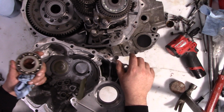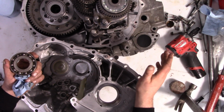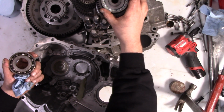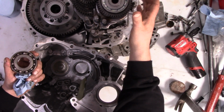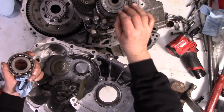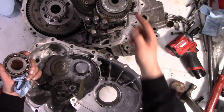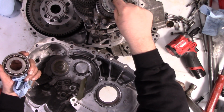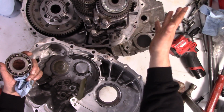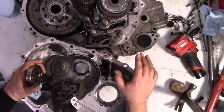So if I do this, my question is, is it really going to recirculate? Is the swarf that's generated in here, very little, but over time, is that going to make it out to the magnet, or is it just still going to stay in here, just a slightly bigger pocket now that I've given it this extra space? In theory, it could escape through here, and once it makes it through here, then unfortunately it'll go through the needle bearings, but the swarf here should be really minuscule stuff, and there shouldn't be a lot of it.